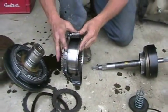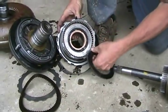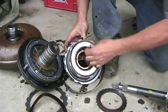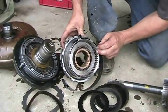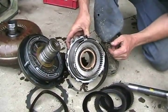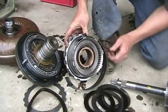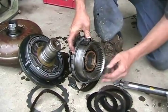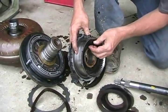This is a four-speed automatic. In the back here is another wet clutch, just like a motorcycle — friction material, drive plate, and so on. When your automatic transmission wears out, it's not the gears that wear out; it's either the bushings, rubber O-rings and seals, or the friction material on these plates. That's how you get such smooth shifts in an automatic — there are no gears engaging. It's always these brakes or these clutches just being squeezed together to shift gears.